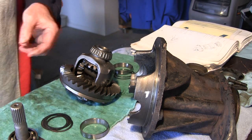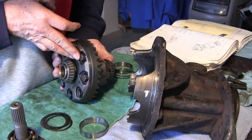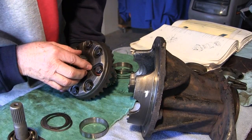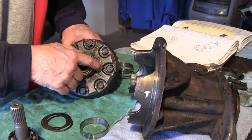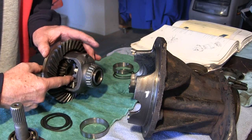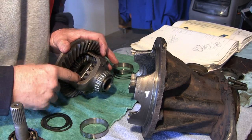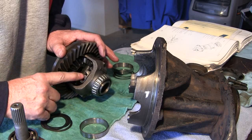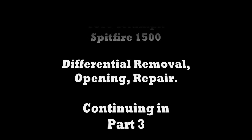I think I'll hold off on knocking the pin out — this roll pin. That might be an access hole right there. Knock that roll pin out and then this — I call it a pinion pin — you can push it out. And then get to the small ones which are planet gears, and the large ones are sun gears. Coffee time.